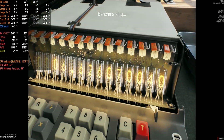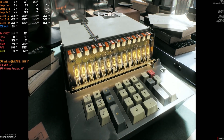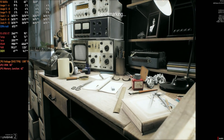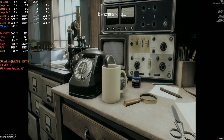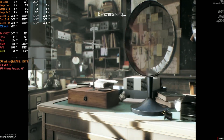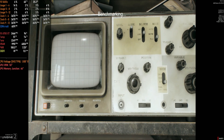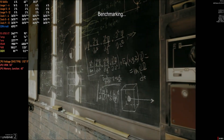I've got hardware monitoring running and you can see the memory junction is great, the VRMs are improved, and it's really just a delta between the core and the hotspot on the GPU temp. Below the RX 6700 XT you can see the edge temp versus the hotspot temp. There is a 10-plus degree delta, which is very good. There are people that have horrible temps out of the box, and my out-of-the-box temps running a good fan curve are pretty decent.